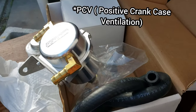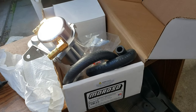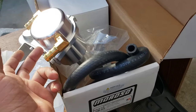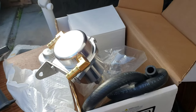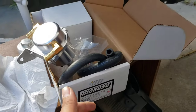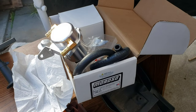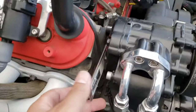I'm putting this in for my PCV — it's just an oil-air separator. I want to pull a vacuum on my crankcase, so we'll hook one side up to vacuum and one side up to the valley cover. There's steel wool in here. I do believe that pulling a vacuum on the crankcase will relieve pressure on the bottom end of the pistons and make it easier for them to go down — that's at least my logic.